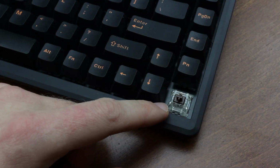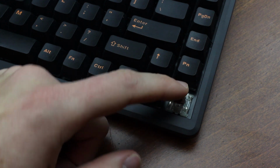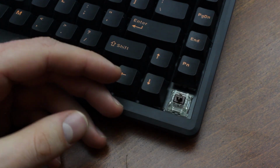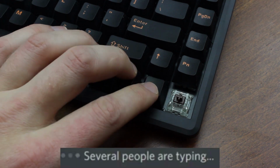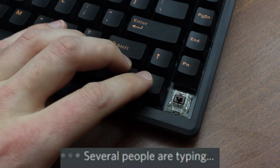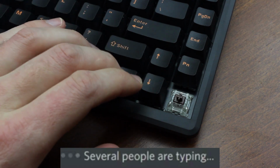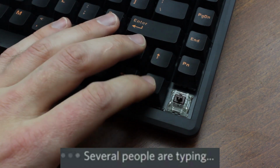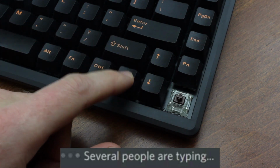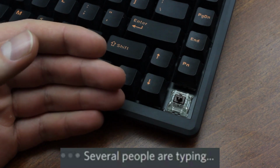The switches are Cherry MX RGB Brown, which is a version of MX Brown with a transparent top housing to facilitate more ostentatious backlighting. These are light linear switches with a somewhat rough key feel, which leads some people to claim that it's actually tactile, although I haven't really found any empirical evidence for this. Overall, I'd rather have MX Red, which are exactly the same except less rough and scratchy. Anyway, that's just personal preference.